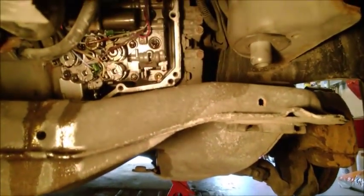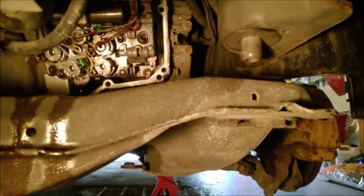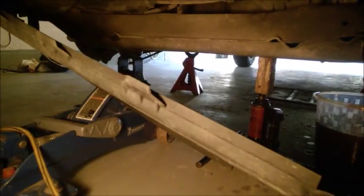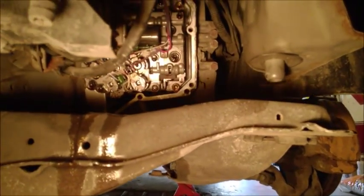One last tip: when you place the cover, put it back in place before you apply the RTV sealant. You are putting the sealant on the cover side, not on the transmission side, so put it on the cover side, going around all the bolts. Don't put too much, because it's going to get into the transmission by accident. By the way, check the RTV instructions.